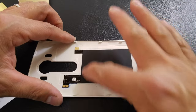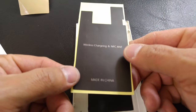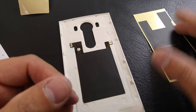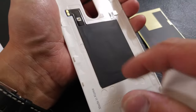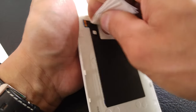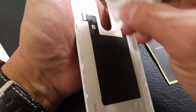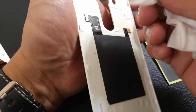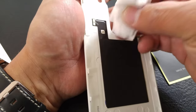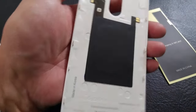That's all you need to do for installing a new NFC coil with wireless charging. You have your sticker cover that goes over this, acting as a shield in case it gets hot, and it helps with heat dispersion — you'll notice the other one had some silver inside. Now the coil is on nice and tight, all good and flat. I'm going to take a lens cleaning wipe with alcohol to clean up all the excess blue marking around the backing. Make sure all our connectors are clean.